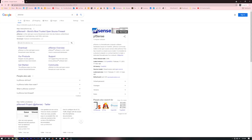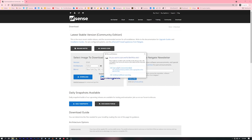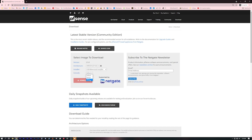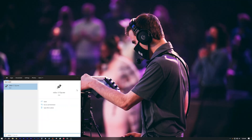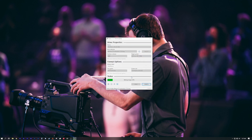The first step in building a PFSense box is downloading and creating a bootable USB of PFSense. Go to the PFSense website, click on Downloads, and then click on Download AMD x86. You want to make sure you're using the memstick installer and that you have VGA set as your console output. This box also has serial output, but I prefer VGA. So I'll download the VGA version and throw it into Rufus with our USB stick and our PFSense ISO to make a bootable USB.